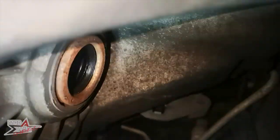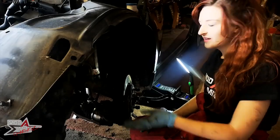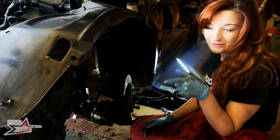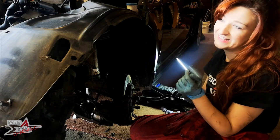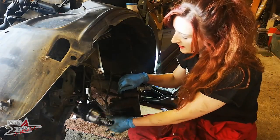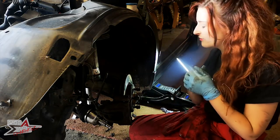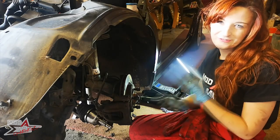So here is the join where it was stuck. We popped in the tuning fork into the gap and then with a hammer it sort of pops its way out - this is post-pop obviously. That's where it is and now it should pull through. The new one is in. Annoyingly though, the one we took out doesn't actually look like it was too worn, so that's annoying - but at least we know they're both done. We will now be doing a little bit more jiggery-pokery to get this back through the hole, then the bolt at the bottom done back up, and then tap-tap with screwdriver and hammer. Then we'll go in for a cup of tea.